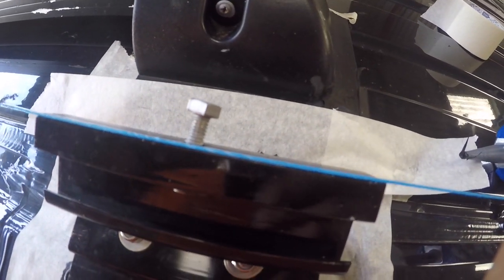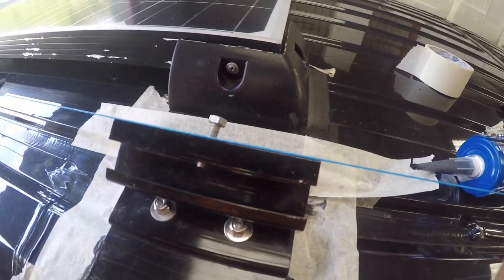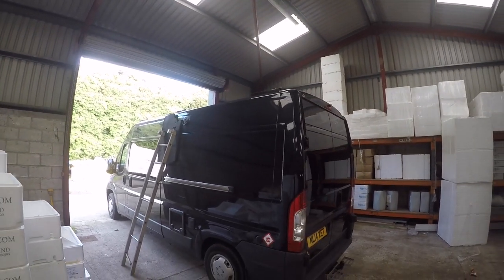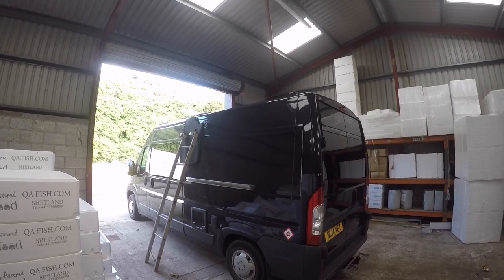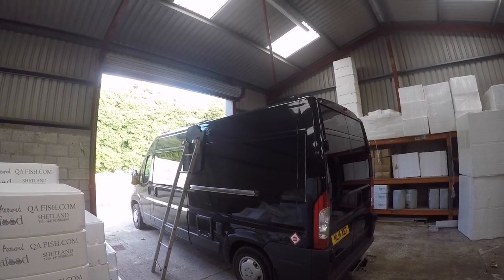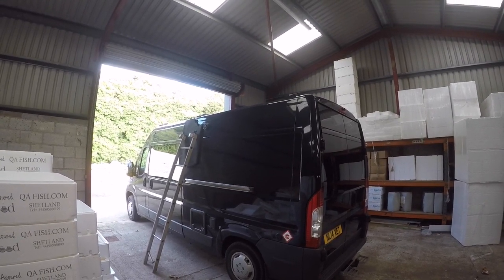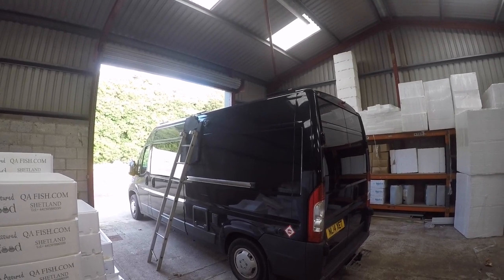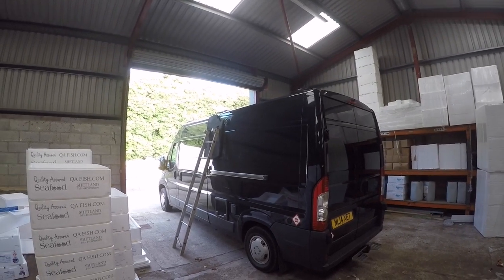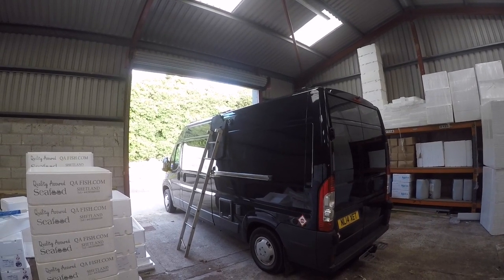So there we are — that's the middle bracket in perfect alignment with the string and I'm confident now that if I allow that to go off the awning should fit perfectly. So that's the brackets on now. I know that when you've eagerly anticipated the arrival of your new toy you'll be keen to get this bolted on and unfolded and admire your handiwork, however I think it'll be best to give this a good couple of days to make absolutely certain that this mastic has gone off and get them tightened down. Because at this time of year — which is now October — it's a bit cooler than normal and we're probably at the lower range of the recommended temperature for this mastic.